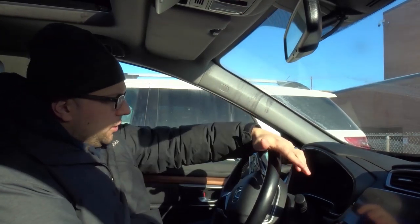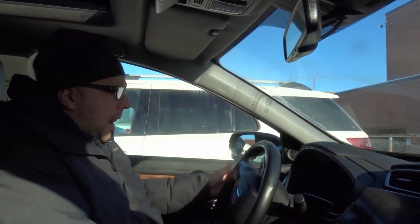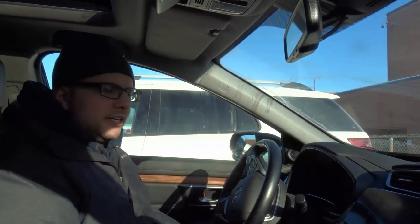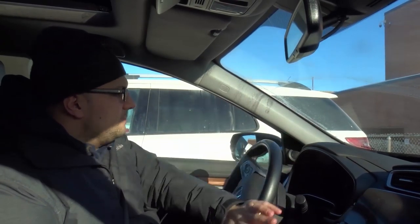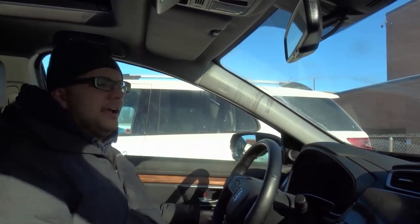For myself it was one and a quarter, so if I'm all the way to the right, I turn a quarter and then one — one and a quarter — and now I know my wheels are straight. To apply this to parking: let's say you park and you don't know how much to turn the wheel. Turn the wheel all the way in any direction — let's go to the right — then take your half number (for me one and a quarter, for most people one and a half) and turn it in the other direction. One and a quarter — there you go, wheels are straight.